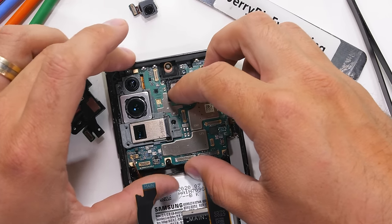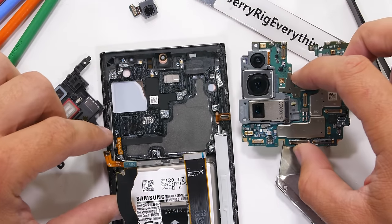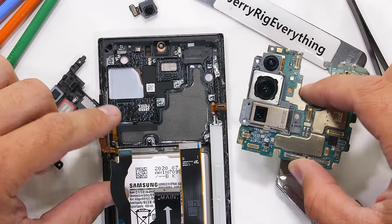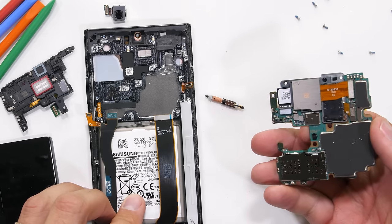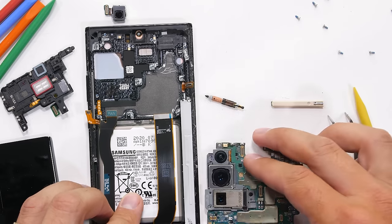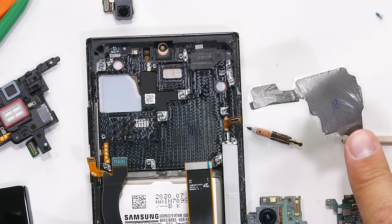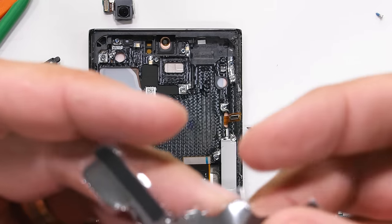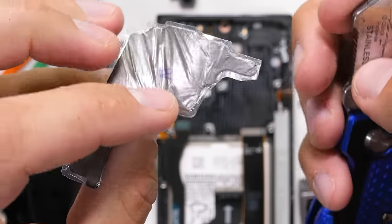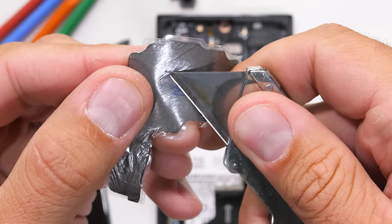The motherboard is tucked up into the top of the phone frame. I can just pull it down and out, and here's where things start to get a little weird. Remember how this phone cost $1,300? There is no thermal paste or copper inside to keep the processor cool — nothing on the gray material inside the phone or on the back of the motherboard, which is super unfortunate, especially because this is an international phone and the Exynos processor is notorious for overheating and throttling.